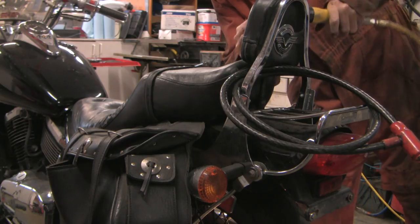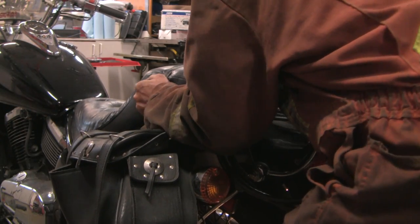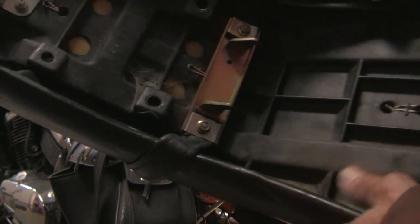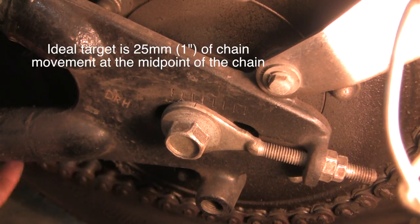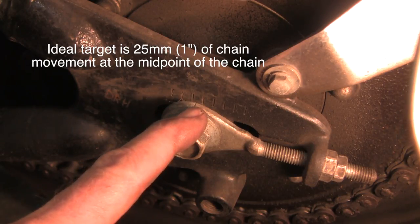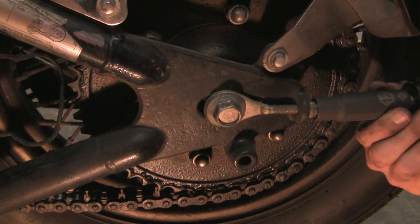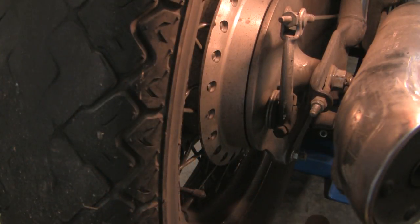I need the seat off so I'll do that now. Here's what it looks like underneath - it just hooks on these two knobs, so you have to push down and then out. My chain tension is a little bit loose but I think I still have a little more life in it. These notches here - you can see that notch lines up with that scale, and as the chain stretches you end up having to move it outward. To take the wheel off we've got to back this completely off to get enough slack to get the wheel off the spindle. This is 12 millimeter for the outside one; the inner one is 14.